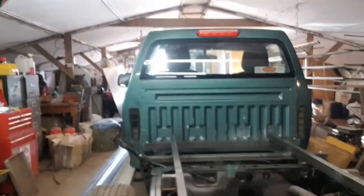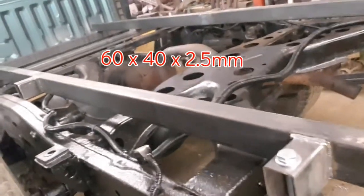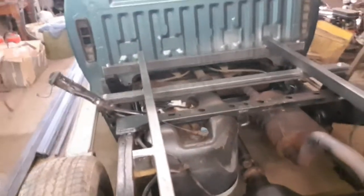Now we're all painted, I've made a start on the subframe of the tipper body. I've used 60 by 40 box section by 2.5 mil thick — I didn't want to go too heavy because we don't want to make the overall body too heavy. As you can see, I've bolted it down to the original chassis, so this subframe is custom built to suit the Isuzu's chassis.